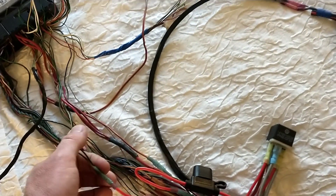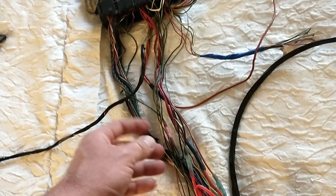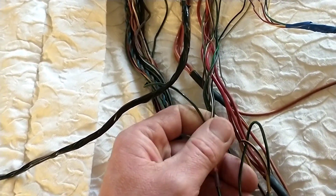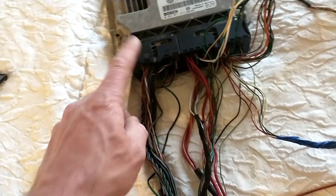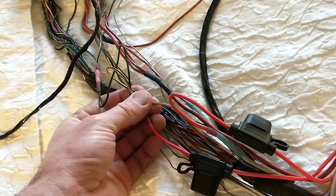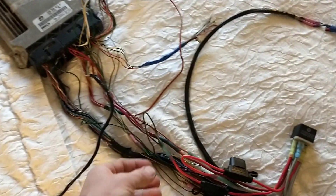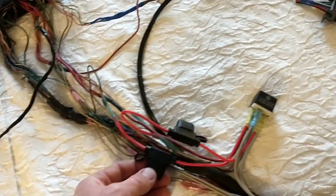You can see I've got that yellow/black coming up here. The relay needs three power wires: a blue/yellow, a black and purple, and a black and green — the two smaller ones are on the big plug, and the black and green is on the smaller plug. I go ahead and just jumper all of those together. They're all pretty much low voltage, low amperage, so I've found it works well to just run them all off one 15-amp fuse.